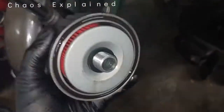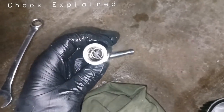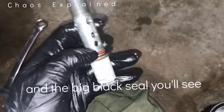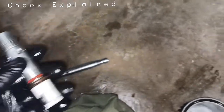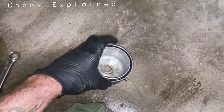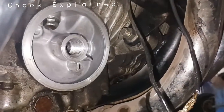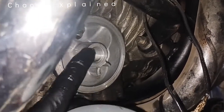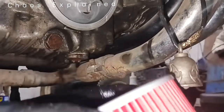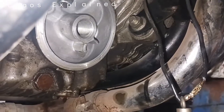I just changed mine so mine's a beautiful nice red. They come in red or yellow. I'm going to pop this bolt out. Don't be overwhelmed — there's a spring in there and a little retainer clip. Don't mess with any of that. If you want to change something, just change that seal right there and call it good. This is the outer seal, and I really suggest replacing that every single time. What we're really paying attention to is this inner metal piece — the part that protrudes outward versus the recess part must press up against that. That's how it's sealed to force the oil through the filter.